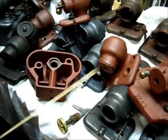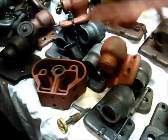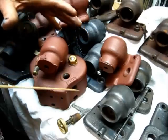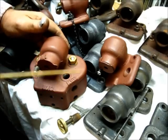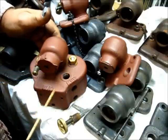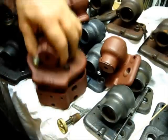Let's get a different mixer here and use this one. This would have been full of gasoline, and that amount of gasoline — when you start the engine on gas and it ran that amount, then you would switch it over to kerosene, and the engine would be hot enough to fire it. They were kind of hard to start on kerosene. The water valve — I'm going to leave that as your homework: what the water in the kerosene engine accomplished. Let's leave that for homework and get on with this.